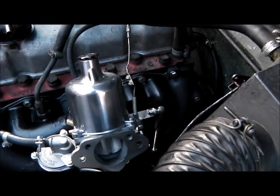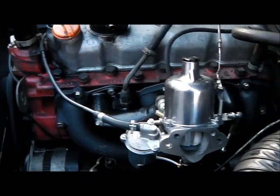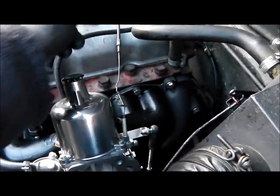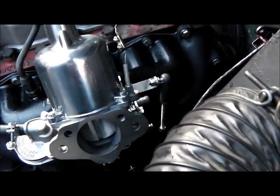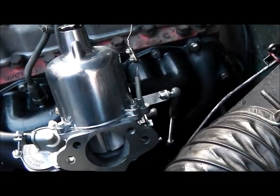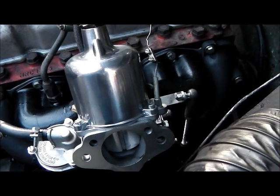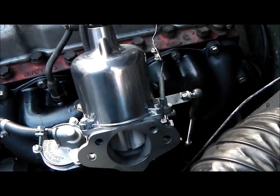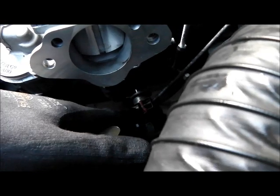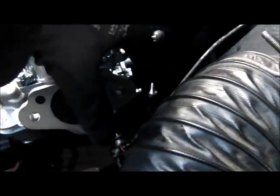So this is where we finished today — just went out of time, getting dark soon. There are a number of things I need to sort properly. The choke cable wasn't long enough, so I pinched a bit off an old bicycle with an Archer hub — obviously it's a complete bodge, I must stress that, but it works and we'll get it on the road. Similarly, these cable ties are just holding the throttle mechanism on. I had to bend this rod and shorten that one — quite a performance.